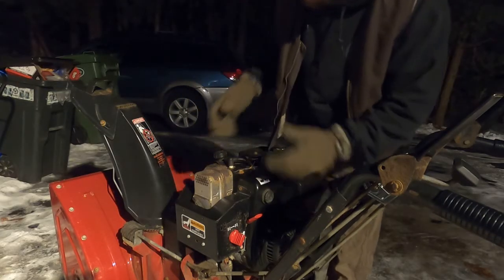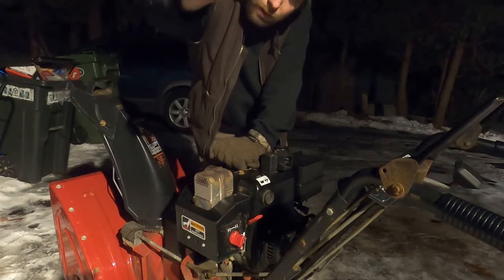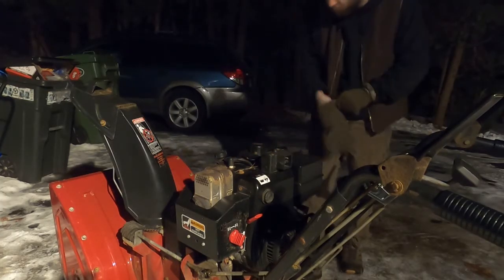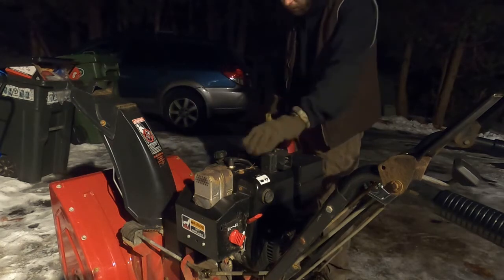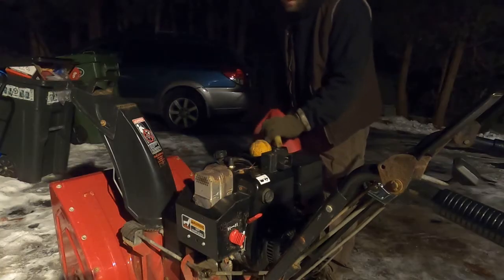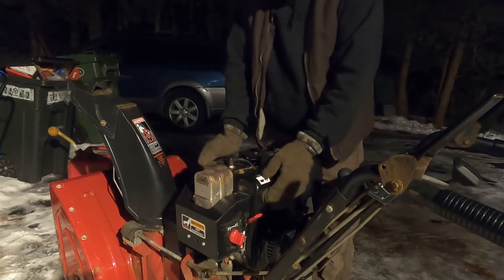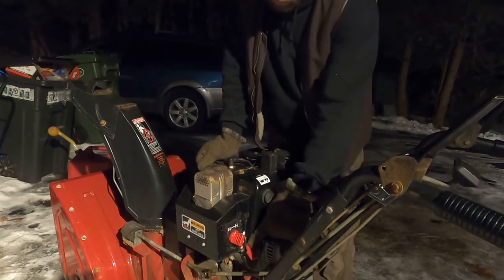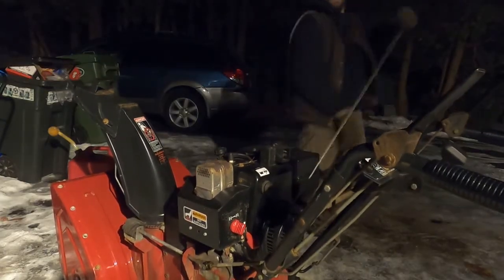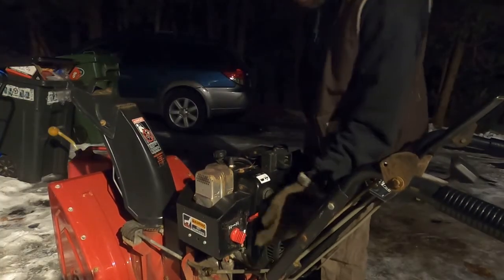It's been at least four hours — closer to six. We let that thing eat. The rag is frozen solid; it is colder than a communist heart out here — this is Jersey cold. Before I left I hit the dump and confirmed the goop made it down into the carburetor, so it's been sitting in there. Next step: fill up with a little bit of fuel — they said leave the Mechanic in a Bottle right in there, don't drain it out. I'm following all the directions — first time for everything. I'm going to pull it over a couple times in the stop position to really suck some of that new fuel in.